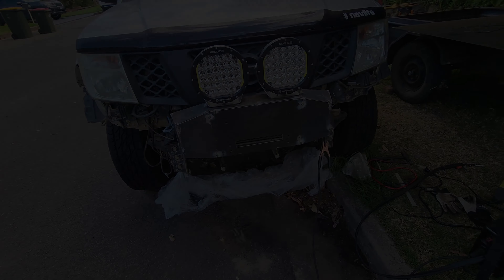I've got the mounts bolted up now - haven't tacked them in yet, going to get them level first. I don't have a bender so I cut them in one piece and bent it. This one's angling back a bit but the ones for my ARB were the same because of this little filler tab - they keep falling out because they're not as thick as the gap. I'll make sure these are all straight up and down on both sides, level with each other, then tack them all in so I can get the next pieces on.